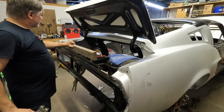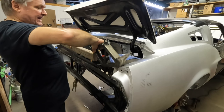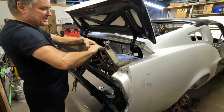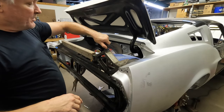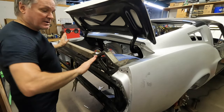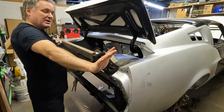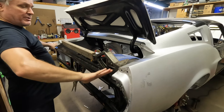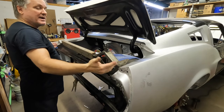I put the 2x4 up against the edge of the other side of the car and then the scissor jack, expanded it until I got it snug and just pushed it out. It'll actually stay where it needs to be. With that I was able to effectively push the ends of the quarters out, which fixed my gap. I would just keep doing it until I got the gap I wanted on either side.